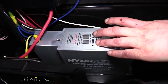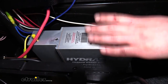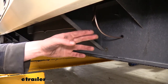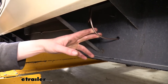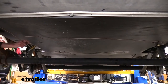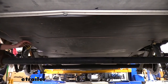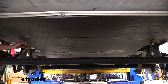Inside our actuator we've got an electrically controlled proportioning valve that helps apply all of our brakes evenly, giving us smooth, consistent stopping performance every time. The lines you'll receive in your kit include one long 30-foot line intended to go from the actuator back to where your axles are. You'll also receive a six-foot line designed to go across from one side to the other, and two four-and-a-quarter foot lines designed to go from the front axle back to the rear axle — one for each side.